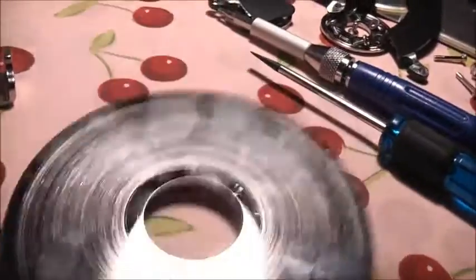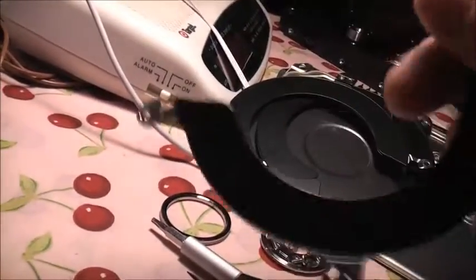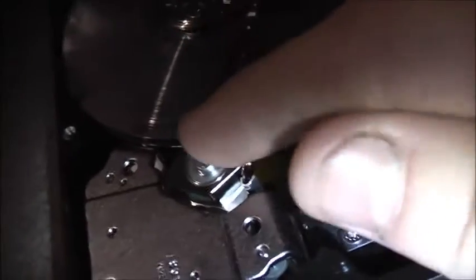Put it back together - I won't worry about these spacers, I'll leave those out. But they're just there to divert airflow in a specific way, that's all they're for. Now I'll put this bolt back in the head stack assembly. It's important you put this screw in, otherwise it will squeal and scratch the heads up.